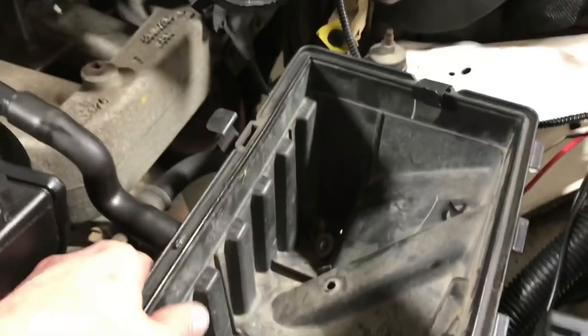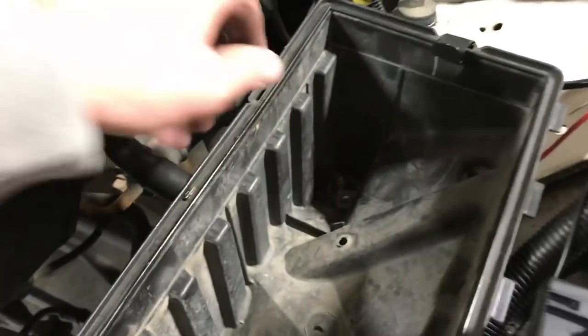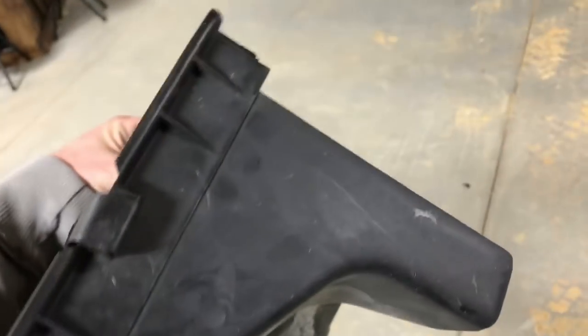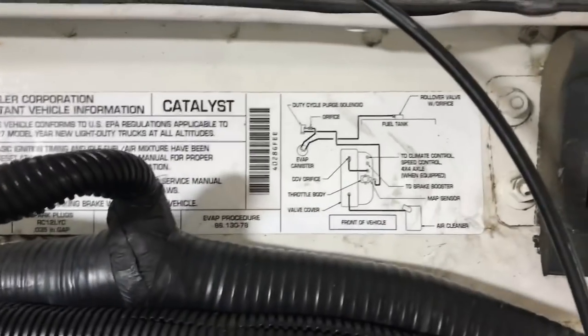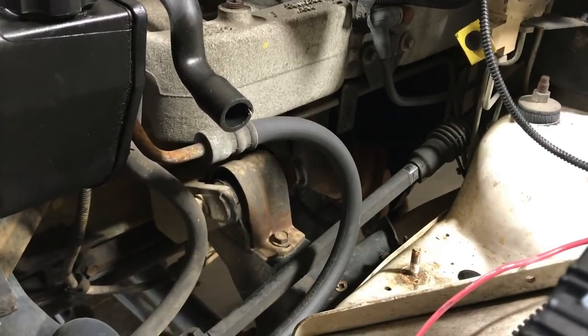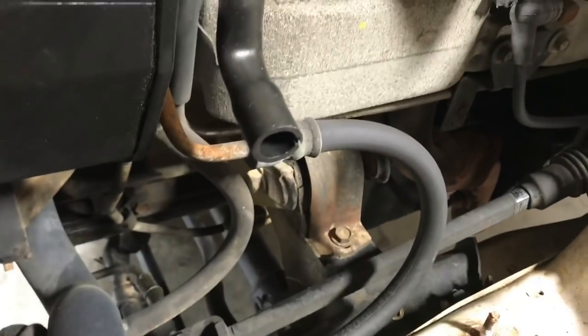After they're all out, just pull up and get it. The rear is actually studded, so it'll be a nut back there and then two bolts. Pull it out and now you've got all this space to work with. We need to start doing some modifications on the box — drilling a large hole right there that will lead up to a large hole right here. Also worth mentioning: if you ever change motor mounts, you have to do this anyway — it makes everything a lot easier. I installed Brown Dog poly mounts on my last build and this build will be getting them as well.